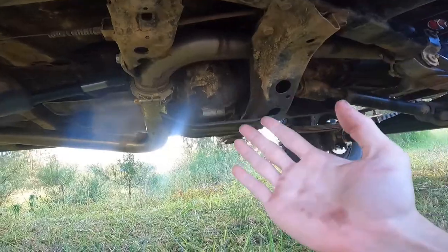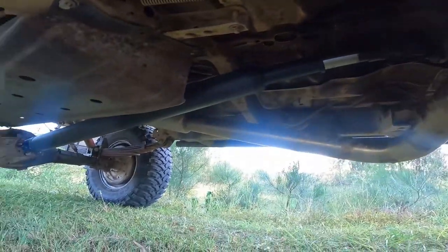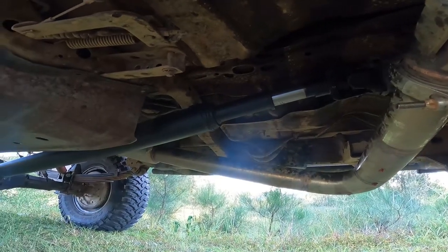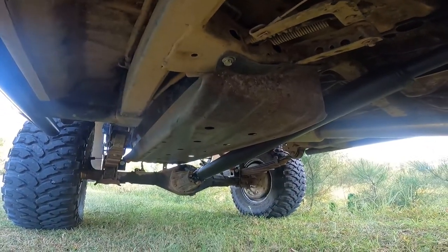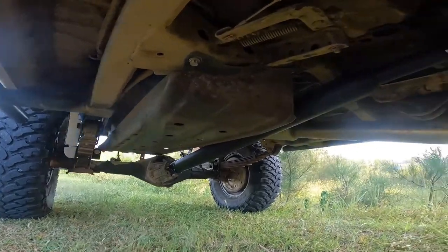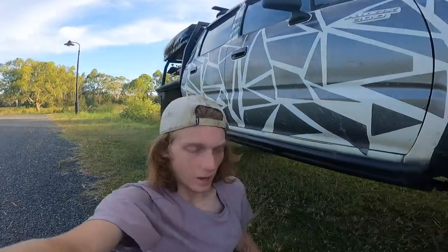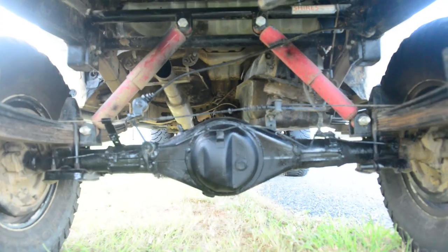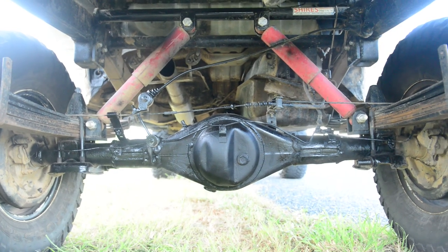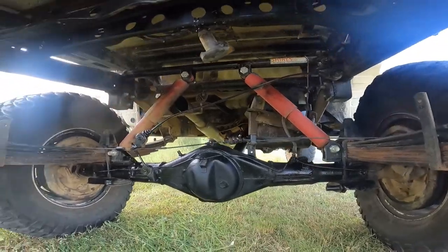Underneath we have a regular G52 transmission — no reduction gears or anything in the transfer, hopefully one day. Out back there's an HD Automotive rear driveshaft, brand new, so I haven't taken it anywhere yet. There's a regular fuel tank under here; I used to have a long-range tank but it was rubbing against the driveshaft with the rear setup, so I've gone back to stock. At the rear we have a Shyze Fabrication bolt-in inversion bar with standard-length shocks, which allows for a lot more travel.